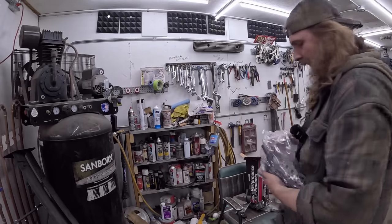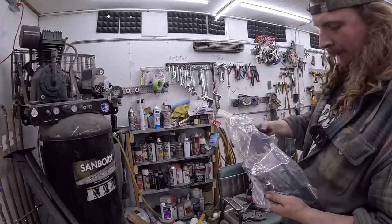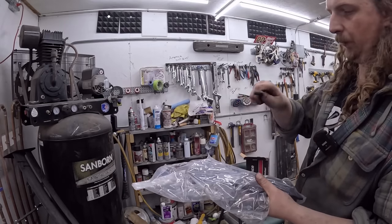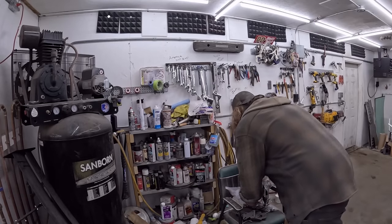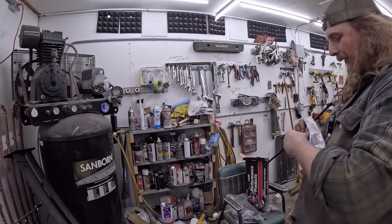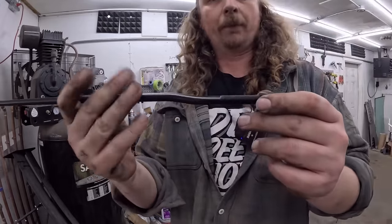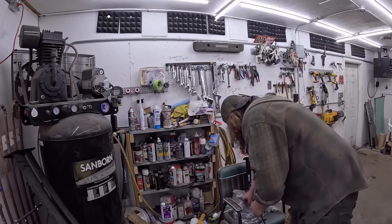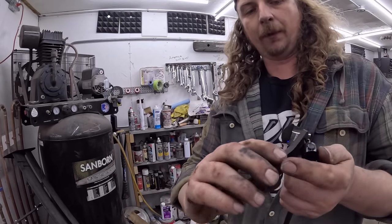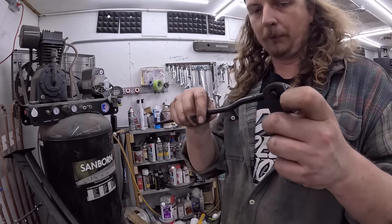So here's all the stuff — these are the rods, which are actually going to control everything because there's a set of levers. It even comes with another alignment tool. It's got metal bushings or oil-impregnated bushings, all the bolts, all the hardware you need. So this plate here is going to bolt to the transmission. There's going to be two bolts that bolt to the actual shifter. Here are the rods — you can see they're threaded on the end. The transmission side is that. And then there's these little ball kind of adjuster ends. You can adjust them in and out. This piece here will go into the lever, and this will be on the transmission — very simple. The transmission has a keyway that sticks out. There will be one of those little bronze bushings with a pin, and all it's doing is first, second, third, fourth, and reverse.